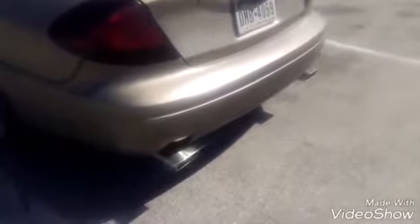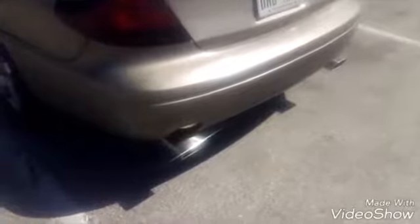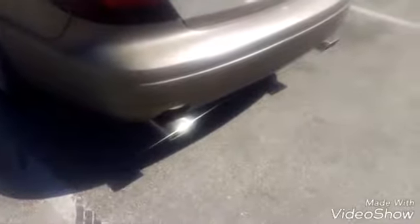As you can see here, I drove it aggressively for a few miles to blow out any kind of contaminants, and it's no longer smoking, as you can see here. The car is officially clean and it runs a lot better. The check engine light that I had is off now — I had a dirty oxygen sensor on one side from when I lost a cylinder on that road trip.